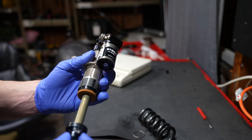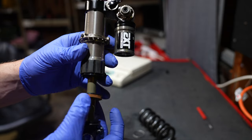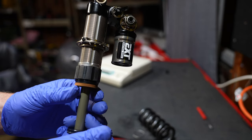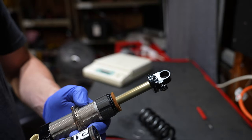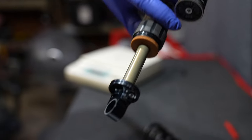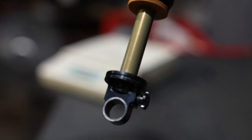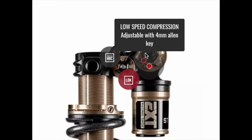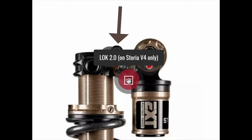This ancient fossil features hydraulic bottom out, long before any mountain bike brand even knew what that word meant. It has a super small bottom out bumper because the oil flow is stopping the bottom out. On the V3, the hydraulic bottom out is preset from the factory or the service center — they told me they could crank it up during a service. On the V4, we can see an extra bulge on the top of the shock, so you can externally adjust the hydraulic bottom out control.